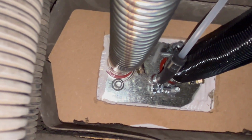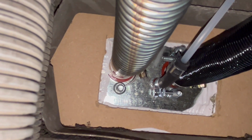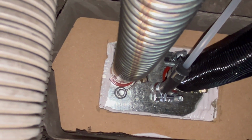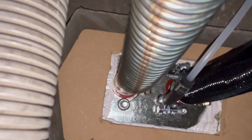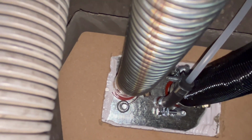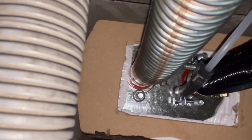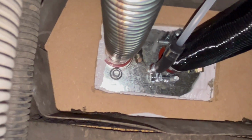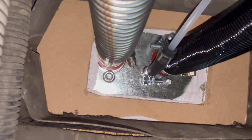Job done, he says. Right, so here you can see that black pipe is the fresh air intake. That needs to be facing forward of the van. There's the fuel pipe, the clear pipe. Get rid of the old fuel pipe that comes with most kits. The clear pipe is more rigid. And then you've got the exhaust here, which should be at the rear of the vehicle. And as you see, 18 tons of glue. There is no air coming out through there at all.